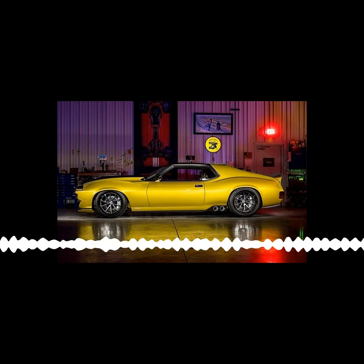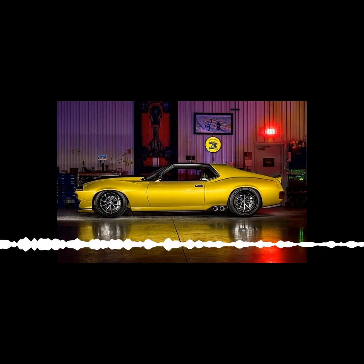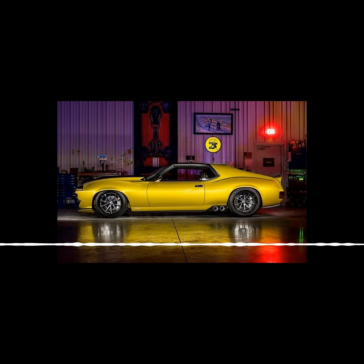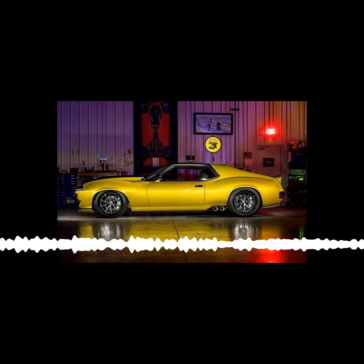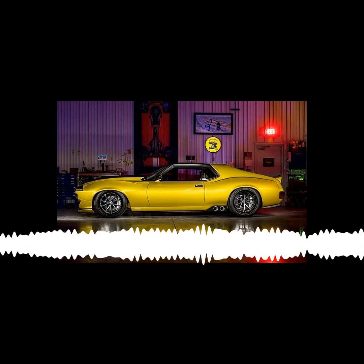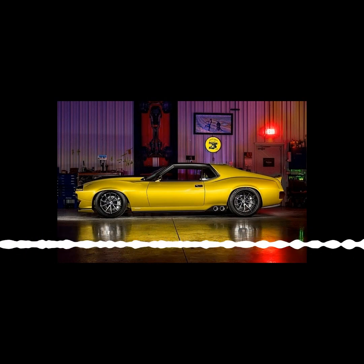But like on this Camaro, it's a one-off car, so we're just milling the actual mold. We're taking 40-pound density foam or Ren and milling a part, and then that's got to be finished off. On 15-pound foam, I might have said 40. 40 is better, but it's too costly. To do a fender, probably in 40-pound foam, you're upwards to $5,000 just for the foam. So it's big money just for the foam to do one fender.